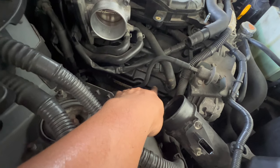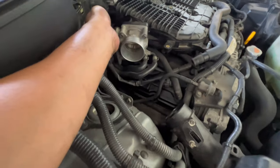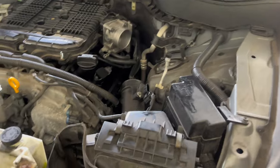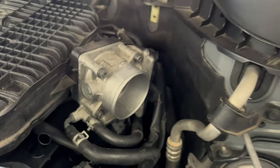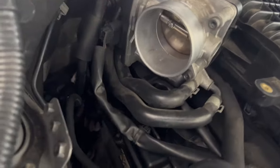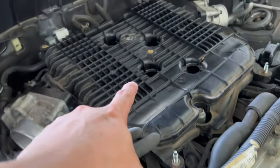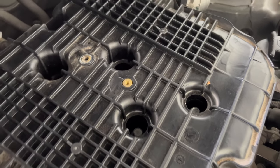I need all the space I can get. You can kind of see the valve cover here. We took out one of the intake hoses — again, we're gonna have to do that on the other side, and then we'll work on the middle. I didn't really take it out fully but I had some wiggle room to remove the hose. I removed the intake hose. Remember there's a special screw here — I took out the three bolts as well as unclamped the hoses. Since they have electrical wires, you don't want to crack or break them. I also took out the battery.